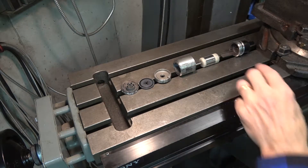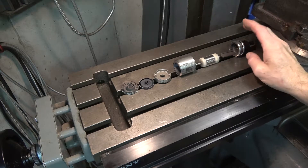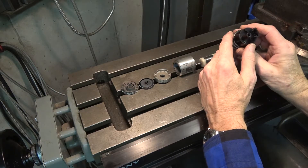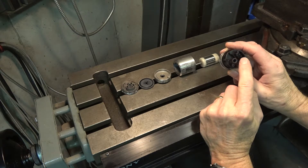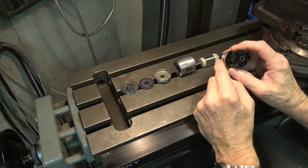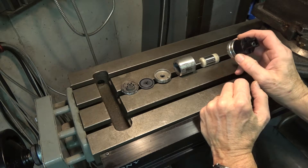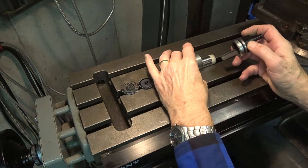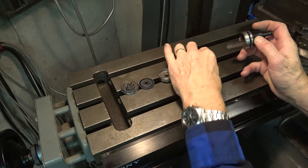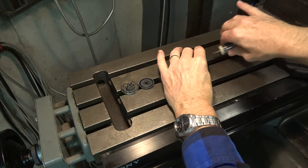I was curious as to what actually went wrong with the old pump — why did it fail? When I tested the resistance between the two contacts it was mega ohms, way too high — no contact in essence. So I cut the unit apart on my lathe into different sections, and when I did that, it was pretty obvious what had gone wrong.